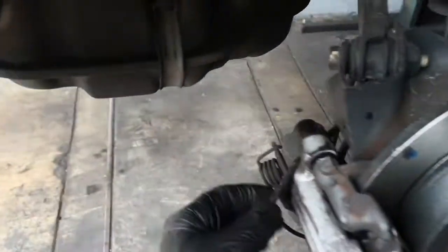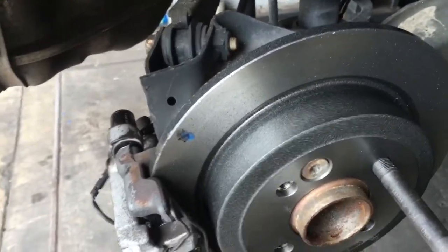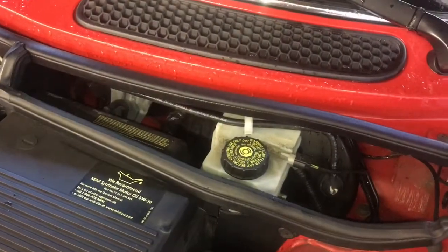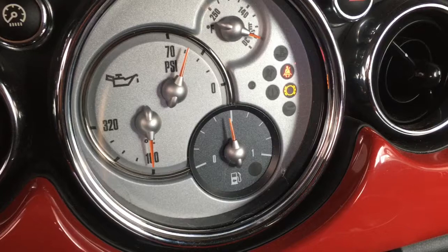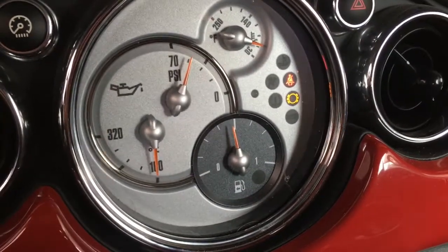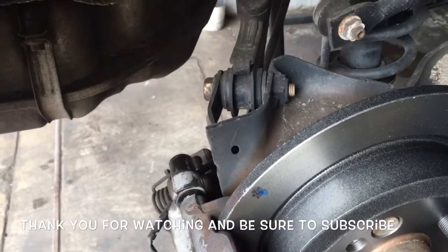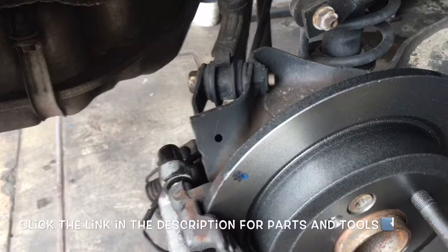Now duplicate the exact same process on the opposite side, except you won't have to deal with the pad lining sensor. Then put your wheels back on and torque those down. Lower the vehicle down and pump the brake pedal six or seven times — that's going to pump the brake fluid back into the calipers, and doing it this way you won't have to bleed the brakes after you're done. As a disclaimer, if the pedal feels funny to you, bleed the brake system. After pumping the brake pedal, re-check your brake fluid level. To get the brake pad warning indicator off, you'll need to plug in a scan tool and go into the brake system to clear that light. If you don't have a scan tool, drive it to your local repair shop and ask them to reset that light. That'll complete the brake job on a 2008 Mini Cooper. I'm Brian Esser from HowToAutomotive — thanks for watching. Subscribe and head over to HowToAutomotive.com for more videos, and I'll be linking all the parts and tools used in this video in the description.